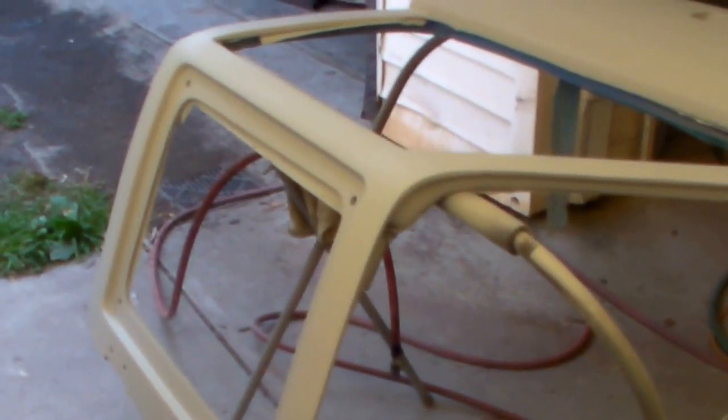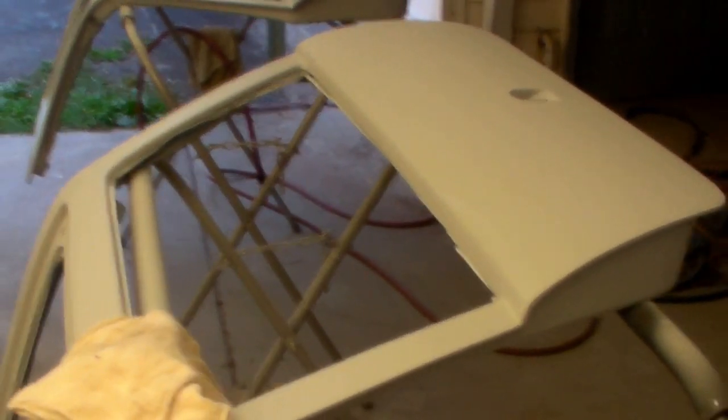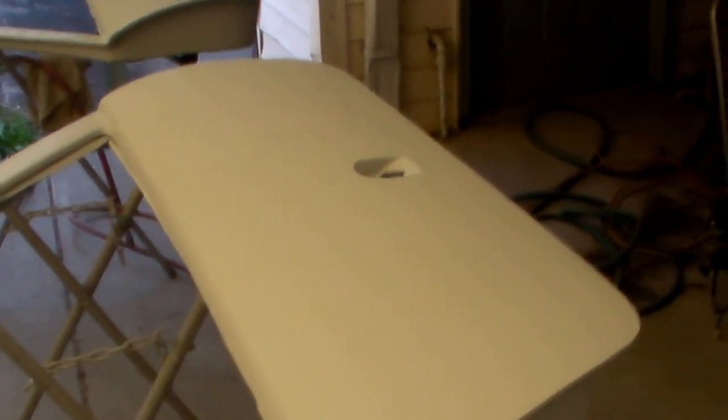Now these are the doors I got off that black one I had. It was black metallic — I believe it was root beer underneath it. And that paint was hard as a rock and felt like sandpaper. These have been bodyworked; little pinholes have been filled, and there were a lot of them. They've been totally stripped; I do have the glass and brackets. They are in heavy primer right now, getting ready to be sanded with 220. They would then get the 2K primer.